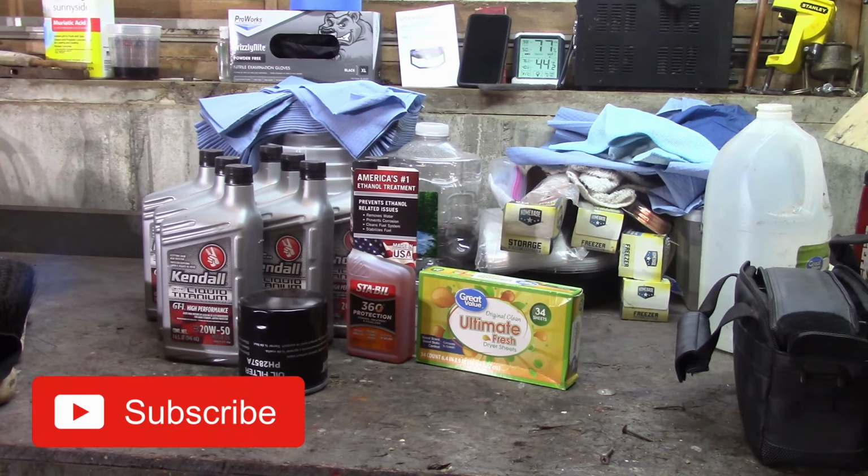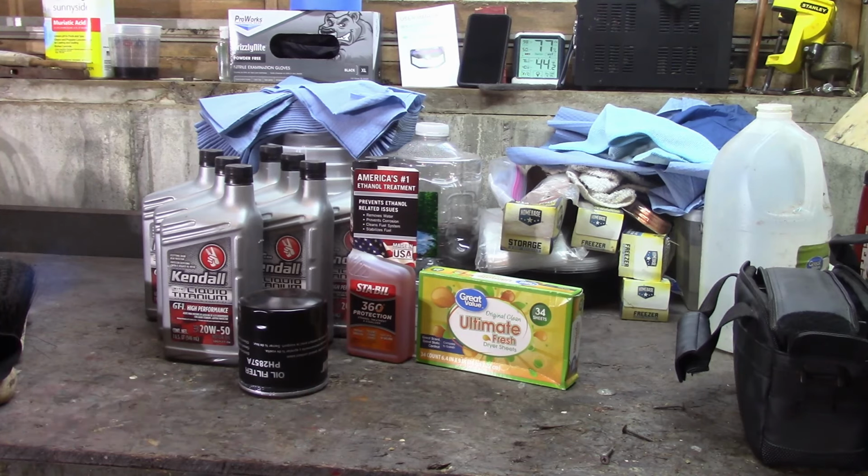A couple of things for that. Advantages to that: one, it gets you fresh oil in there, and any of the byproducts or wear products or the acidity that may have built up in the old oil over the season is going to get flushed out. You're probably well under a normal oil change interval, but then again, you are putting the car up, and good fresh oil will help. New oil filter goes without saying along with that.